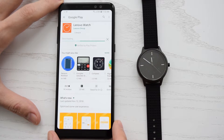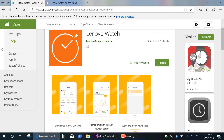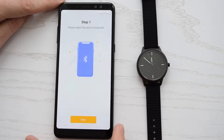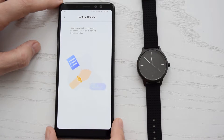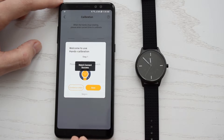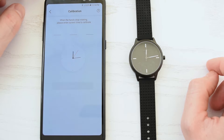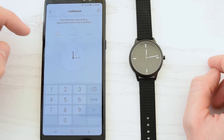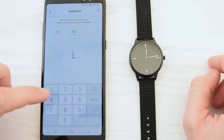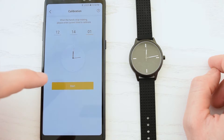To get the most out of your watch, even to set the correct time, you have to install the Lenovo Watch application, which is available on Google Play and App Store. To pair your smartwatch, simply follow all these steps. Now shake your watch or press the side button. If for some reason your phone can't find the smartwatch, press and hold the side button for 6 seconds to restore the watch to its factory settings. This watch automatically synchronizes its time with the connected phone, but first we have to calibrate its hands. Simply enter the time that froze on your watch — don't enter the real current time.